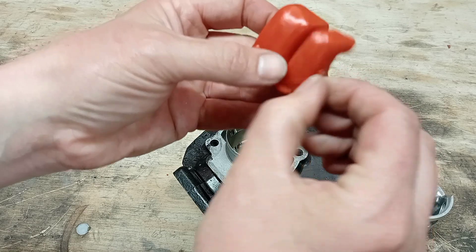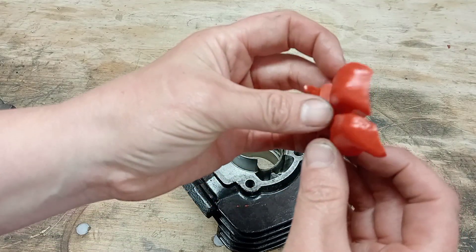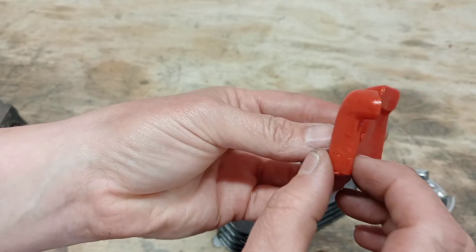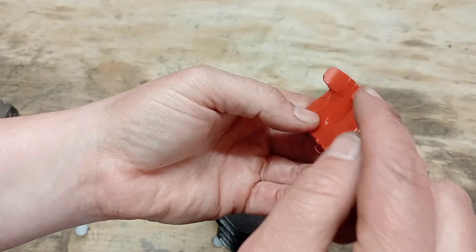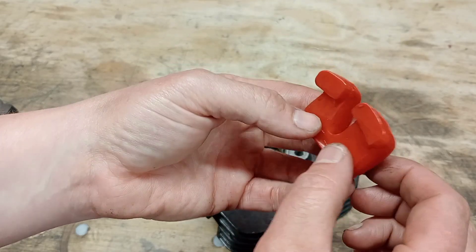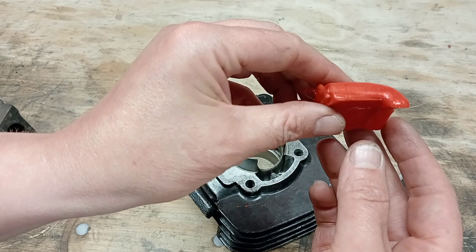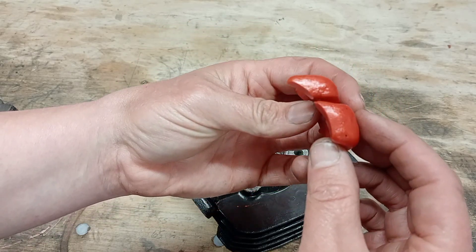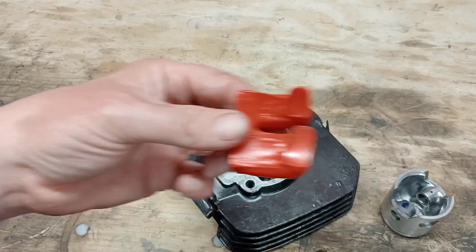You can see it's got a release agent on it anyway, and then it starts to come out. There you go — there are the ports. They are very nicely done. Not ideal — ideally you want a big sweep like an RSA — but this is quite an old cylinder design, so it's got old-style transfer ports. However I can see they look quite good.